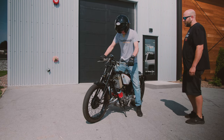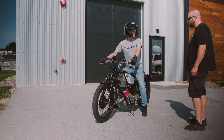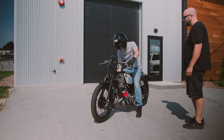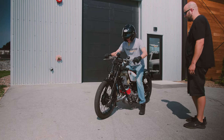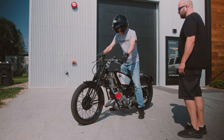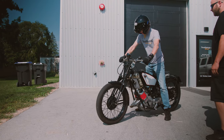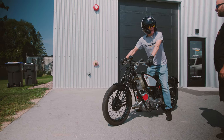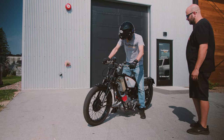Give it a swift kick with a little touch of throttle. It's so light between your legs — light, like a motocross bike. Everything is so low. We're in gear; I'm going to find neutral, which is down or half-way. Got neutral. Got a little choke? Choke, yep. So just a touch of throttle and then a kick. This all feels pretty normal.